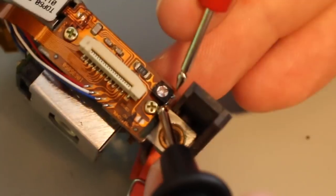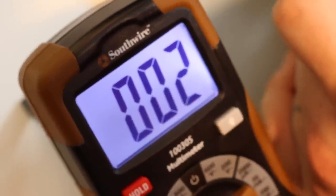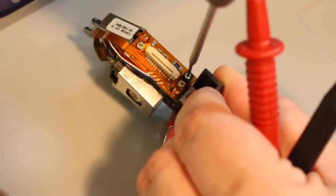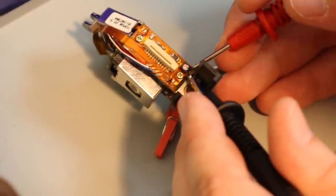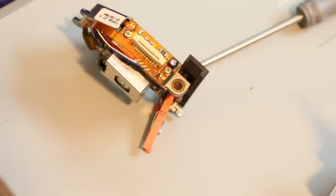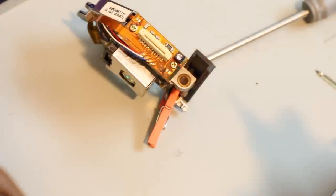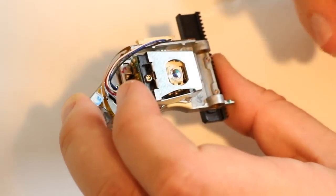It's hard to get a good reading on camera without a proper clamp. Right now it's reading 2 ohms — that's probably because I've been messing with it. We want it to be at about 3.7, so we're going to turn it up. We're on 3 now. I'm going to go ahead and leave it at 3 — my meter won't do decimal points, and I'd rather be lower than higher because lower means less resistance, or more current.